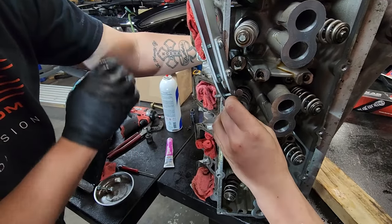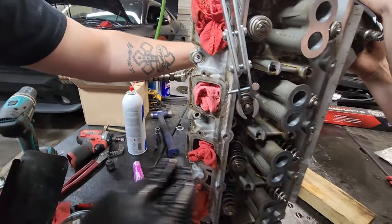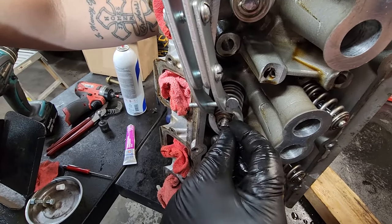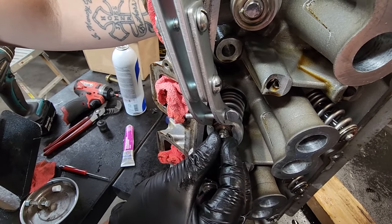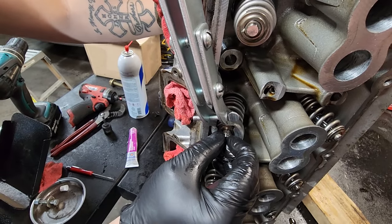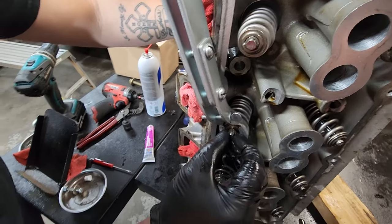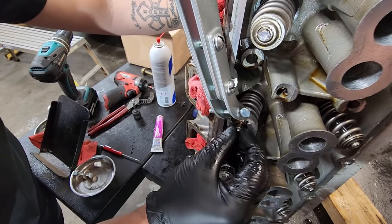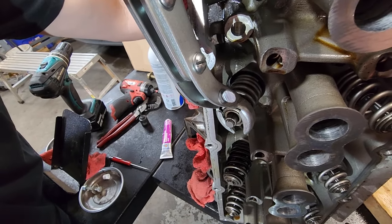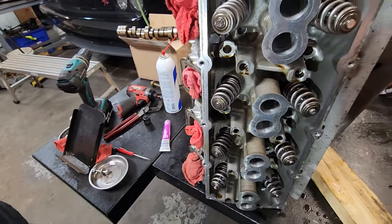I have him try to start the other one — or drop it on the floor again. Try to reach over there and crank that thing to tighten it. Crank the spring down a little bit — there we go. So now we got both keepers in, as you can see. We're going to release the tool — and one spring done guys!